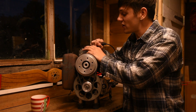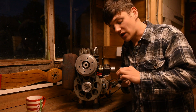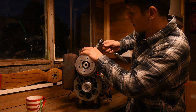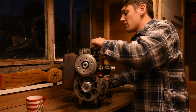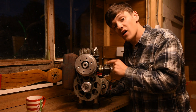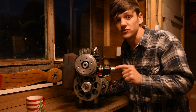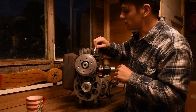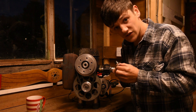First things first, pull this cap straight off and that reveals your spark plug. Take your spanner and socket, whip it on like so, and to the left — undo that. Mine came out fairly easy because I've already pre-loosened this. Chances are yours are only nipped in there, so don't go cramming it because you'll probably cause damage to the threads. Let's remove that and check to see what we've got.